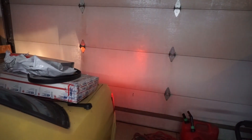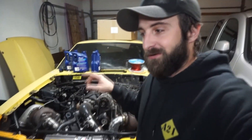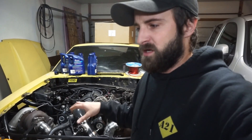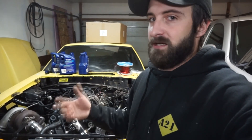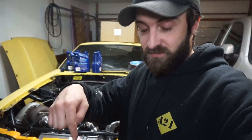The brake lights do work, so that's good. As you guys could probably hear in the first drive video, it was a little whiny — sounded like a supercharger, like a blower whine the whole time. I believe that was the transmission whining. It was only doing it when I was rolling, not when idling or with the torque converter running, so I don't think it's pump whine. I think the fluid just had water in it — I never checked it when I bought it. The dipstick hole had dark red fluid on top, but I think water was settled to the bottom.